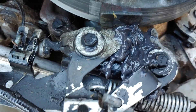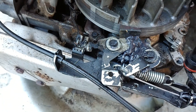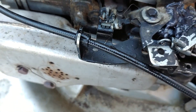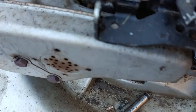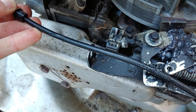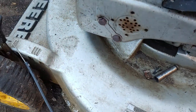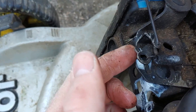We need to disconnect this cable and undo these two bolts right here to get this off. There's also a wire going around that that has to be disconnected. I did have to disconnect the throttle cable to be able to get it out of that part because the opening on top isn't big enough for it to squeeze through, so you actually have to disconnect the cable. To do that you just unbolt it from here and then pull the linkage out from that hole right there.